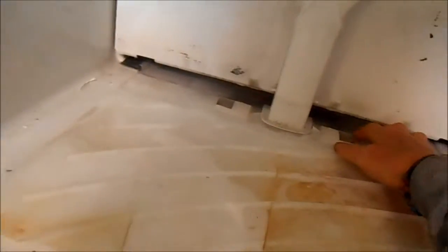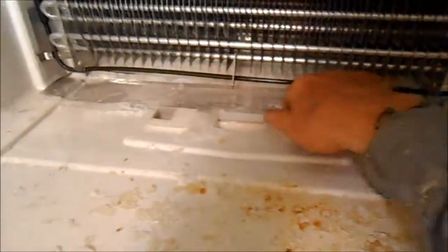This problem here we're looking at — see the ice built up here? This ice has clogged up the drain. What we have is the occasional melting from the defrost action going down here. So this all has to be cleared out and that drain right there has to be cleared so that we don't build up ice. You can see there was actually ice all over this and this will clog the drain.